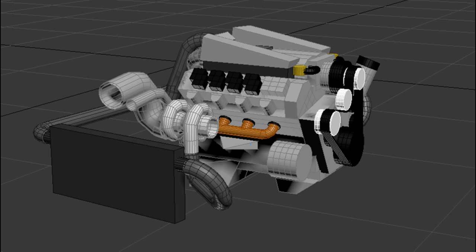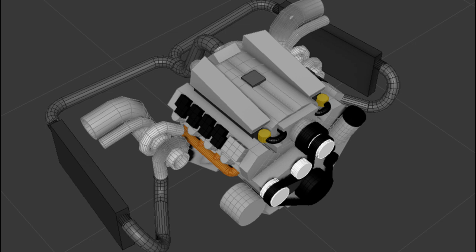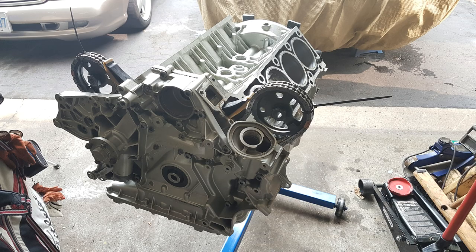The plan is to move the turbos to the front and possibly get rid of the supercharger. The supercharger alone weighs 40 kilograms, and the rest of the system — intercooler, heat exchanger and all — is close to 50 kilograms, so that's a lot of weight to save. Moving to different manifolds and a turbo-only setup should free up extra horsepower and save significant weight. I haven't finalized the next project design yet, but I'll post a video on it when I do. Next video will cover bolting the heads on and finishing the rest of the engine.